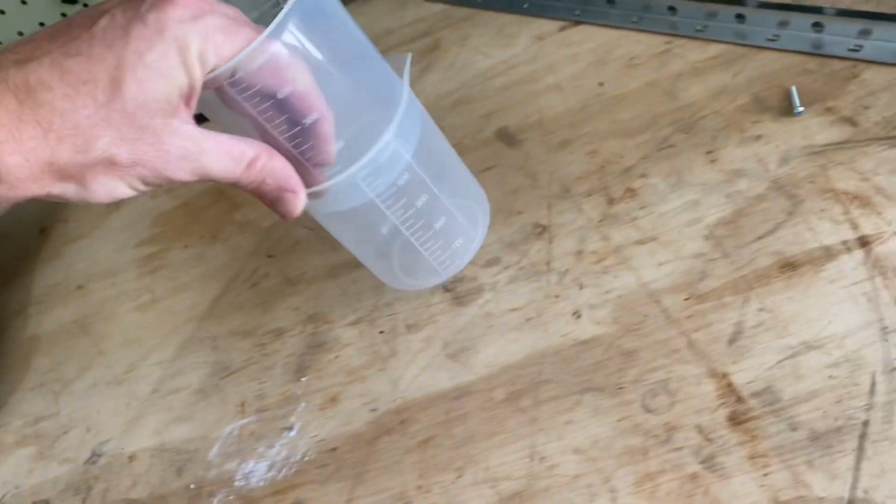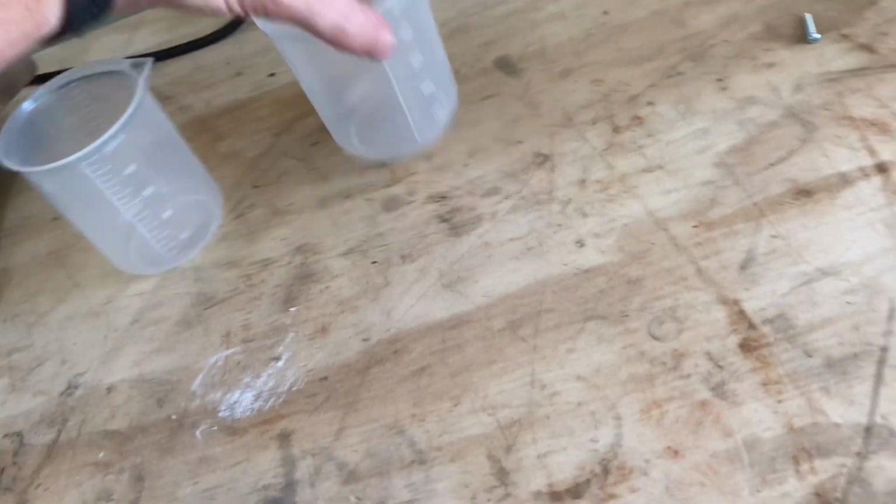Now I am gonna add some fiberglass over those stringers in the floor that I took out in the driver area. This is gonna just make sure that they are extra waterproofed if they're not right now, and strengthen them up even more. All right, we're gonna get started on some fiberglass work to strengthen up the stringers in a couple spots.